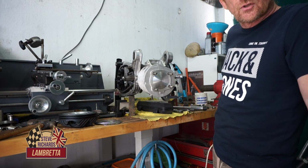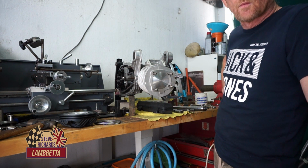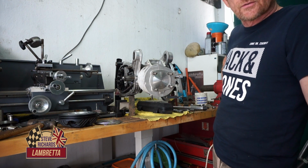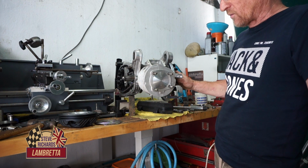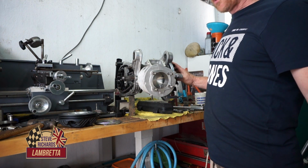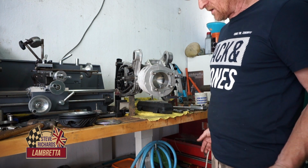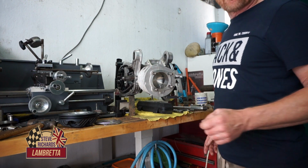So now we can calculate and do our cylinder head volume in a bit, because now we know our squish clearance is 1.2 mil. We can account for that when we measure the volume in the head, because we need to know what the volume of the head is for our compression ratio. Because we still might have to go all through this again, because I might have to remachine stuff. But at the moment everything's going sweet. Right, brilliant.